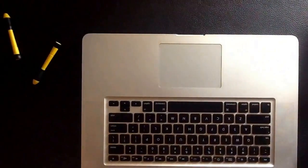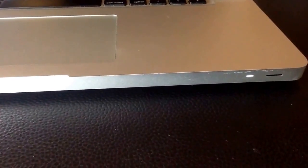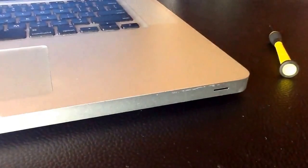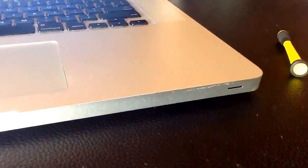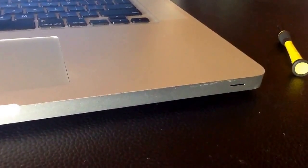There we go — what a beautiful thing! That's awesome. You just need to reseat the RAM and hopefully that gets rid of that annoying problem where you're getting the three blinks. It's just telling you to reseat your RAM — maybe something got jiggled loose, and that'll solve it for you. Thumbs up the video, and in the description I'll provide resources for some of the different things you might need to do this on your computer. Good luck!